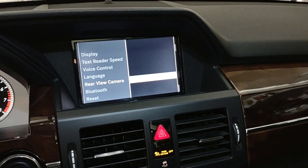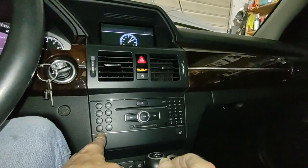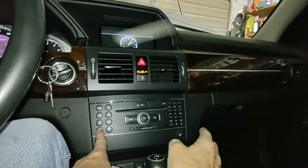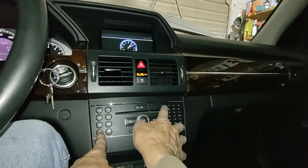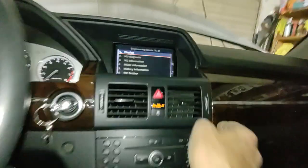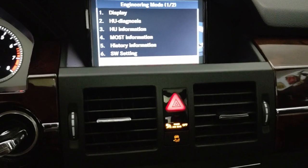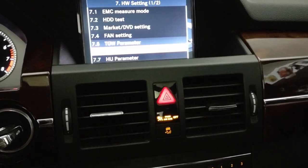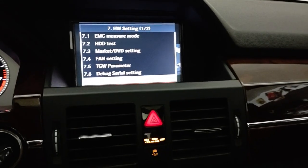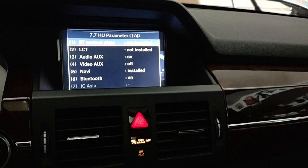For those who don't have that option, I'll show you how to get there rather than going to your Mercedes dealer. I'm going to enter the hidden Mercedes engineering menu by pressing the hang-up button, the pound or hash button in the corner, and the one button simultaneously for a few seconds. You'll see the screen switch to the magical Mercedes menu. Navigate with the toggle down to Hardware Settings, then to 7.7 — head unit parameters. You can see what's installed and optioned in your car this way.